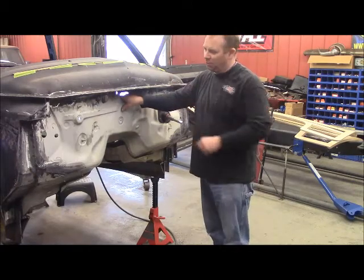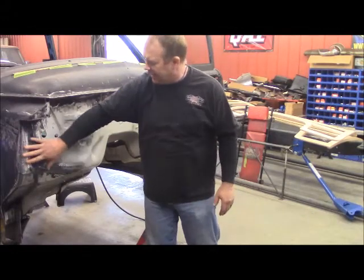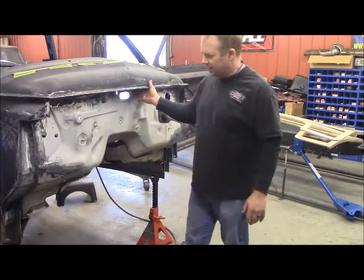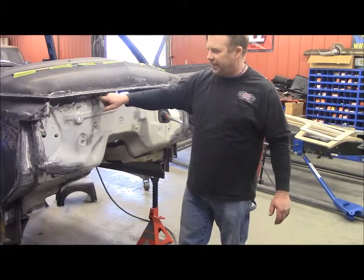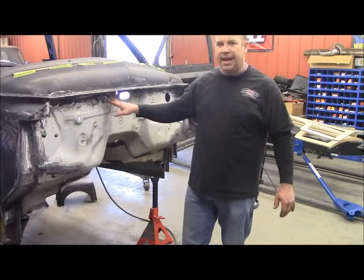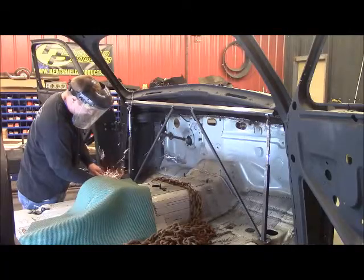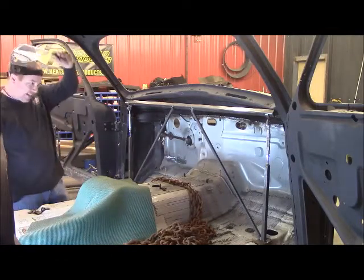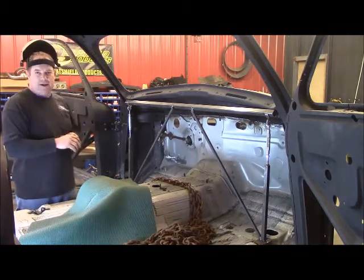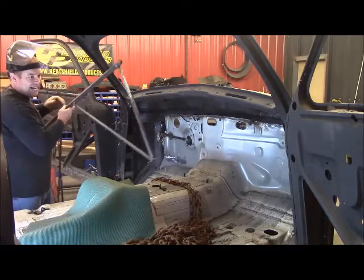The Woody and Explorer are really becoming one now. You can see I've got your firewall done — I've had to cut a little bit of the Woody off here and then blend it into the Explorer firewall, but it's welded in all the way around, fabricated all the panels all the way around. I've sealed with the two-part 3M adhesive both sides of every weld and I'm letting that cure. I went in here and knocked the top off a little bit of it. Now I'll let this cure on out, go inside, and remove the inner support. That's my last cut on this post support — this thing's been in here for quite a while setting these front A-posts, but now it's a moment of truth. Get this thing cut out and removed, then we'll shut this door and see if it stayed where it was.